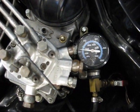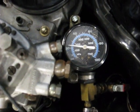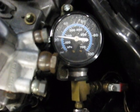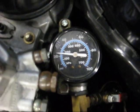My fuel pump is jumpered and running, and the first thing to measure is cold control pressure. As you can see, mine is set right now at this temperature at about 24 psi.